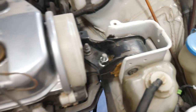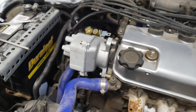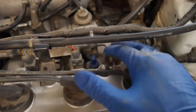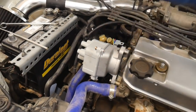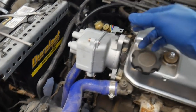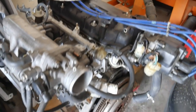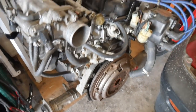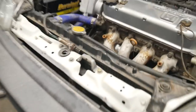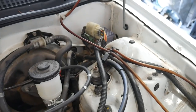After getting the header and the motor mounts removed, another thing I'm working on — I'm converting it to OBD1, which is kind of a backward process. But since this car already did the multipoint swap and I used OBD1 injector clips, it'll be easier to get the injectors on here. I had already purchased the harnesses because that was my intention. Now I need the distributor and the PM6 ECU, because I'm going to be selling the ZC swap to one of my friends. We're going to put it in his CRX along with a set of rear disc brakes I got off the old track car. I just have to wire up the O2 sensor and remove the resistor box and plug those together.